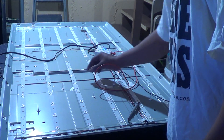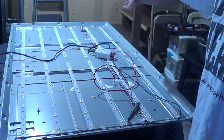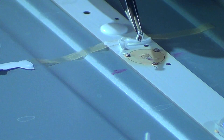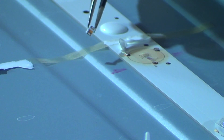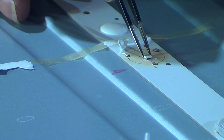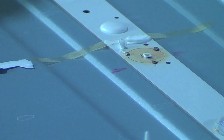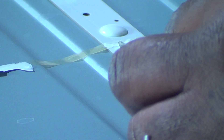I'm putting the LED cover back on just to show you there is an actual LED right there. I took all the covers off the shorted ones so I know which ones are shorted — same on both sides. My replacement LED is actually opposite polarity, so I just scrape one end of the positive side there. One side is negative, one side is positive — anode/cathode. I'm going to get TV repair critics asking why I didn't use the correct polarity LED — well, it's because I did not have one.